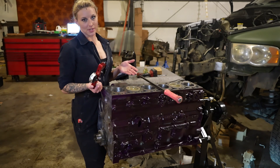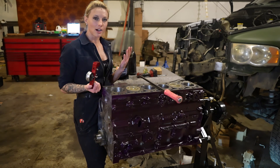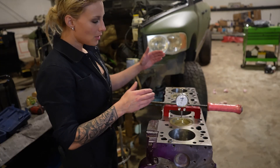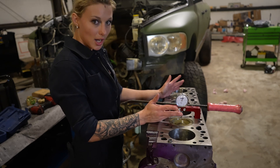That specification — six to nineteen thousandths — is from the Cummins manual I got off Diesel Laptops. We're just going to do cylinder two and cylinder five because those are the ones that are up right now; they're companion cylinders.